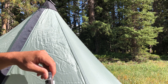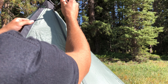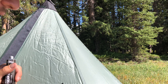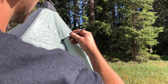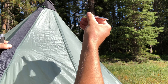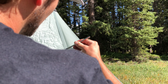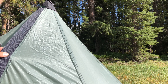Getting into this, what we're going to do is lay down a small bead of seam sealer right here. Run it short at first if you're inexperienced. Then take that brush, run it along, build up a bead, and cover the seam. What we're looking for is to cover both of those stitching lines right here, and we're already off to a great start.